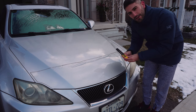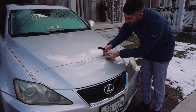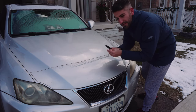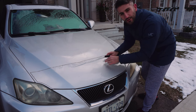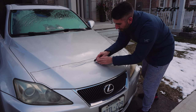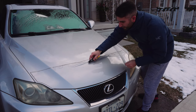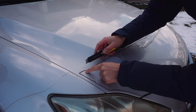We're looking at the clear paint protection film. The first thing we're going to do is take out an exacto knife — I know you're going to be scared, but you have to be really careful. Think about where you want to cut. Because the damage happened about an inch and a half down from the edge line, I'm going to cut about two inches down. You're going to show just a little bit of the exacto knife blade. Start at the edge and think about not digging into your paint. You're just scoring the film — not cutting into the clear coat. Also, this is not a straight line because of the curvature of the hood, so follow the curve to make the clear bra look like it's flowing in the shape of the hood.